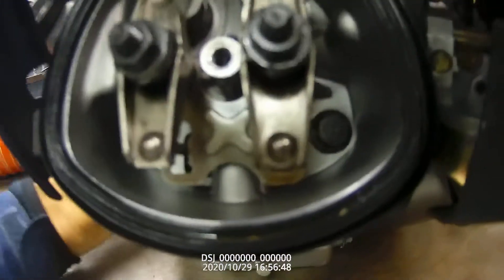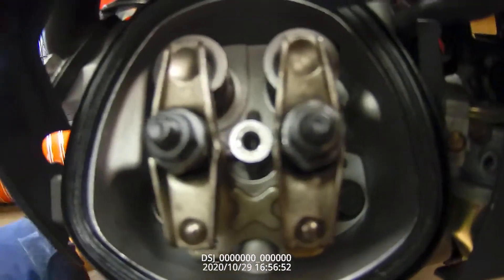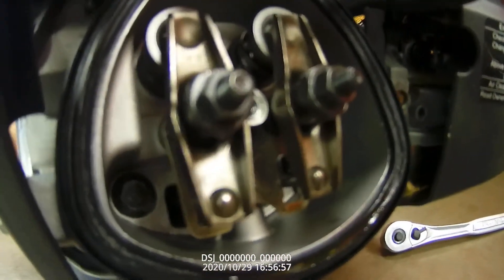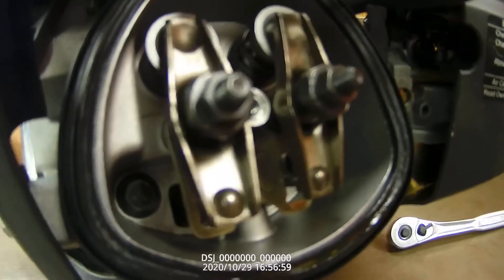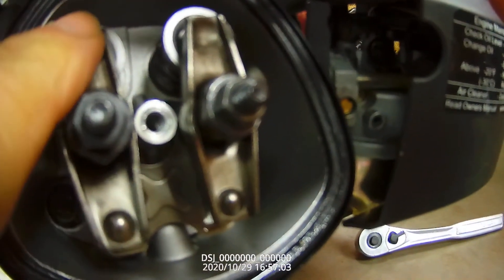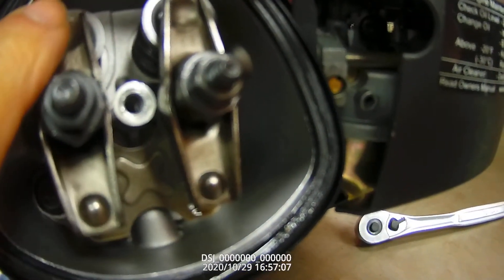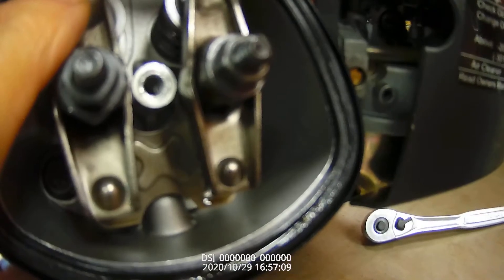If I am rotating this engine, I am going to see the valves. There's one moving. If we go back, you can see the actual spring compressing. So if that spring is compressing, the valve is inside of there — that means it's opening.